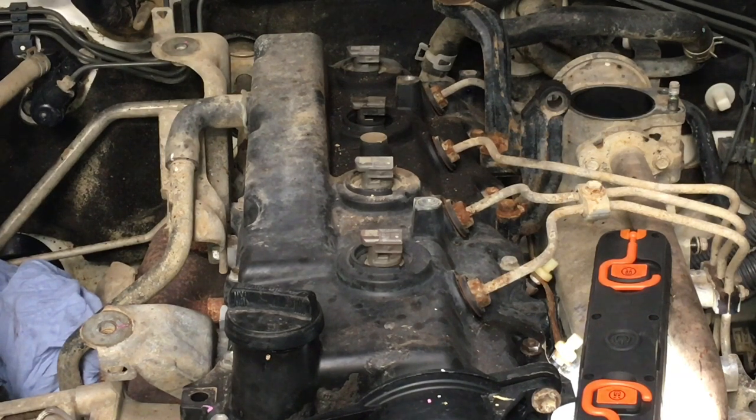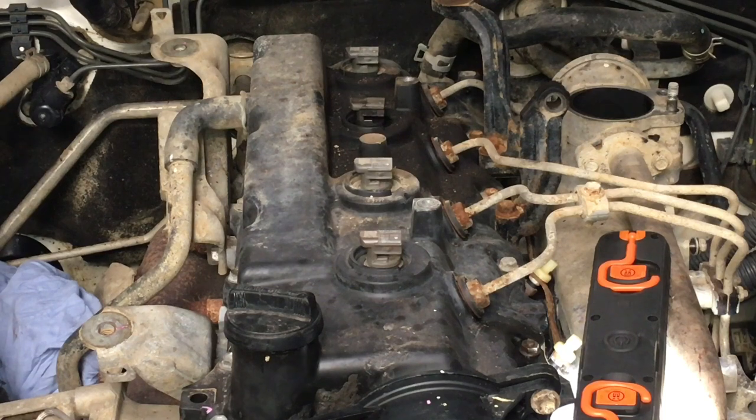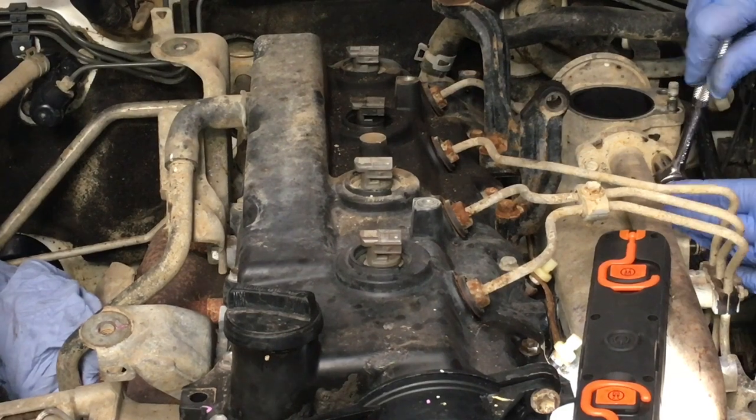If I just wanted to make money, I'd just go for it and bust them, and then say, mate, this happened, look at the video. But I could ring him up and say, hey, what do you want to do? Do you want me to risk busting it? The car's 16 years old. It's about an 05 or 06, the early one. Let me have a look at the plate. It's March 05, must be one of the first ones. So the vehicle's 16 years old. It's a lower emission model, which means less EGR flow, which is why you can get away with having this pipe here.